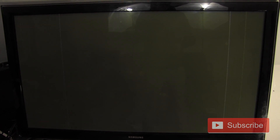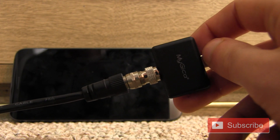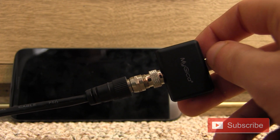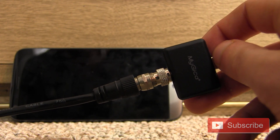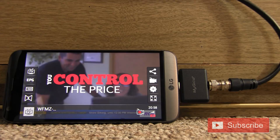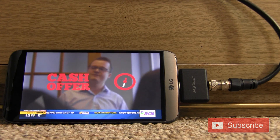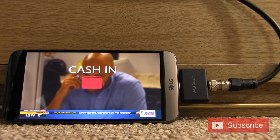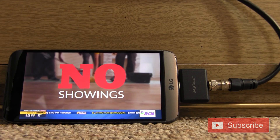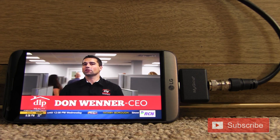Something really interesting I discovered is that the main signals weren't coming in on my external antenna, mainly because it's very directional and not pointed the right way. I got an MCX to coax adapter to plug it directly into the tuner, and I was curious if it could pick up stations my TV won't. Sure enough it does — I don't understand how a channel can't come in on one TV tuner but comes in perfectly on another. It also picked up WBRE out of Scranton–Wilkes-Barre, which doesn't currently come in at my antenna position on my TV, but this managed to pick it up.